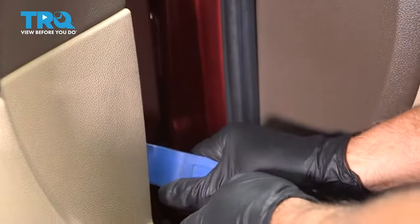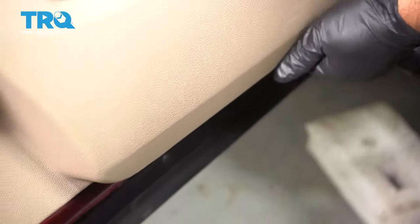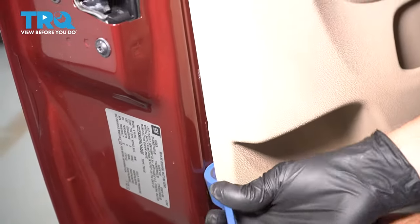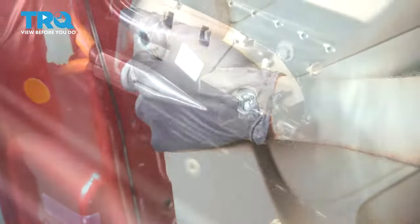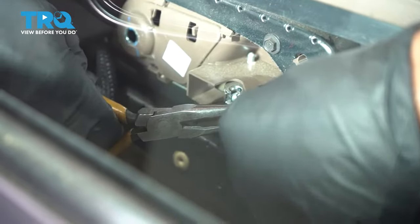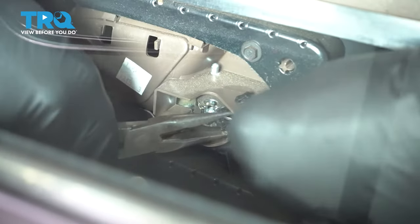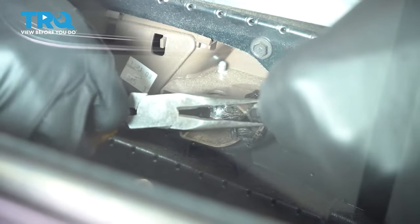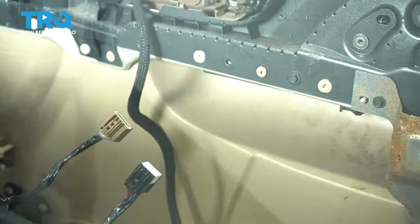Using a trim tool, you just have to pop the clips, grab the panel, and pull this cable off. Use some needle nose pliers — there are some clips right here. This one is a bit messed up. Push on those two little tabs, then slide the cable with the ball out and slide the panel out.